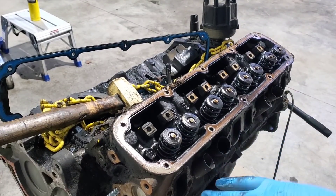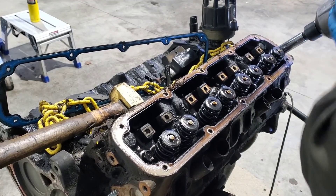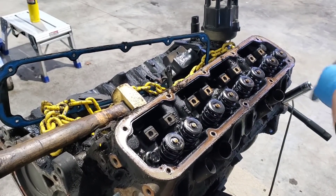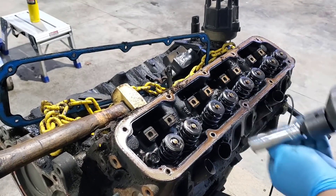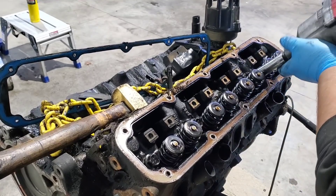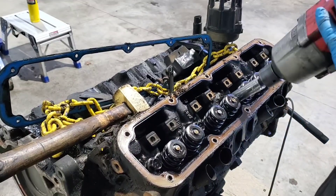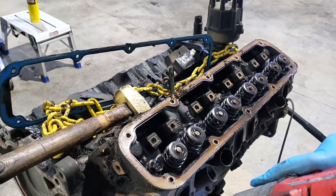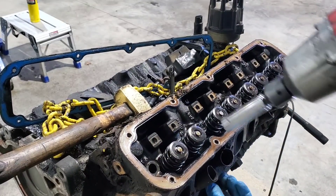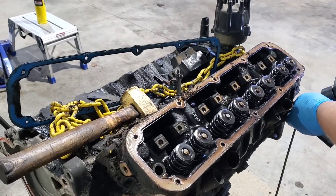Okay, so we'll see what this one looks like. This one definitely had a bunch of wet exhaust valves and ports. Even the tops of the valves look really good. Now, we're definitely going to be putting valve springs in it, but that's just because of the cam that we're going to put in here — I'm going to see a little bit more lift.